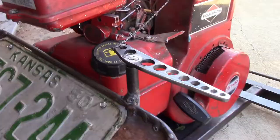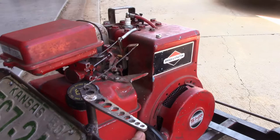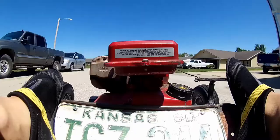I did get some work done on Saturday — I did test out the foot throttle and I think that turned out pretty good. But I kept throwing the chain even with the chain tensioner on. I think I figured out it was my walnut chain tensioner: I'd worn through it so much that I started creating a ridge — the two sides of the chain link were deeper than the middle, and the middle was getting hung up and popping it off. I sanded it down, but then I sanded it too far, which made the chain too loose. Now I think I have to remove a link. I did re-gear the go-kart and that's what I was trying to test out.